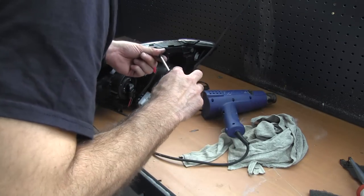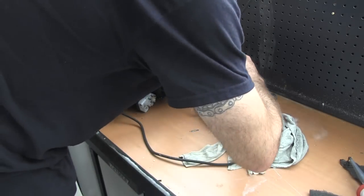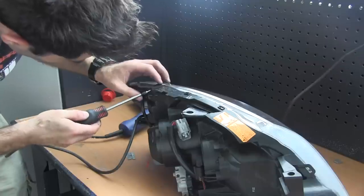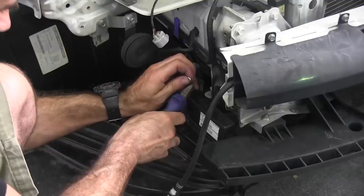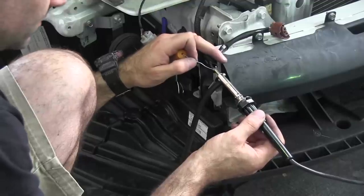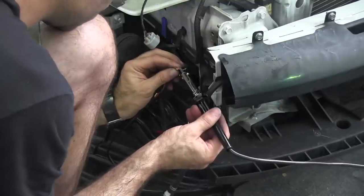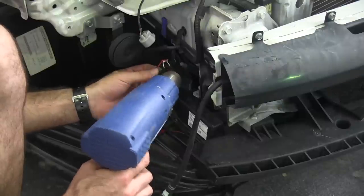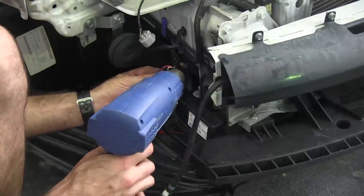While the sealer is still a bit tacky, screw on the 5 screws around the headlight surround that attaches the lens onto the body. Now it's time to attach your demon eyes to a power source. I'm going to use the fog lights so that when they come on, the demon eyes will come on as well. You can create your own switch or do it another way, but this is just an easy way to power up your demon eyes.